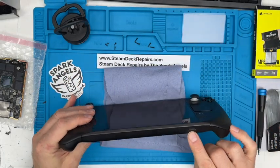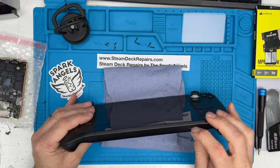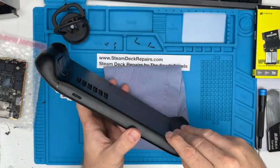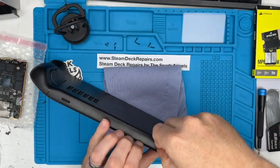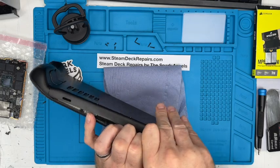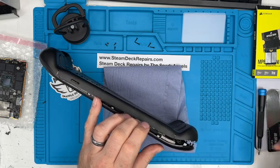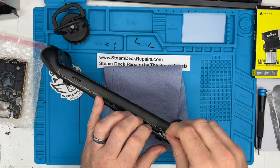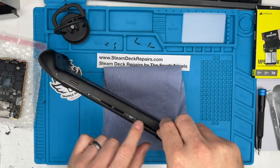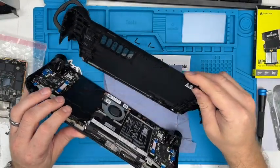We'll start at the bottom. First thing you need to do — always remember — is to pop out the SD card if it's got one in, because if not it stops it from opening and you're going to end up snapping or doing damage to the board. Going in somewhere on the bottom and just popping it open — I love how easy it is. Just with your nails, or you can use a non-damaging pry tool or something plastic and you're getting there. They've got clips all the way along the bottom — just pop the clip, pop the clip, pop the clip.